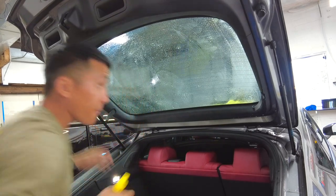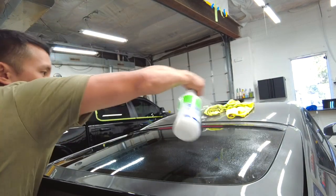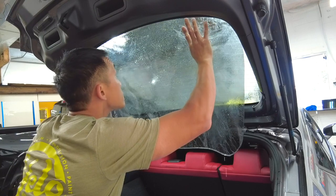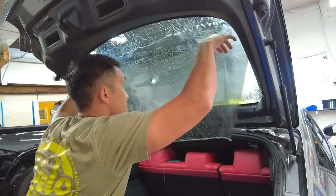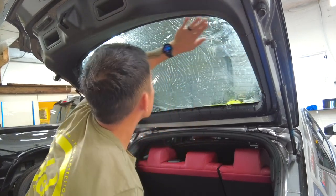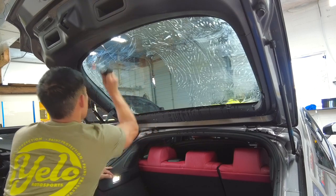I'll roll this door down just a little bit. Since it's a hatch I don't need to remove anything — I try to work quickly so I don't give contaminants much chance to get on the glass. Starting from the top, get it all flush — once everything's in the glass you just lock it down. Double-check to make sure the film covers all the dot matrix. Everything's covered; now just get some water out with no pressure — literally just dressing it and getting rid of some of the water.